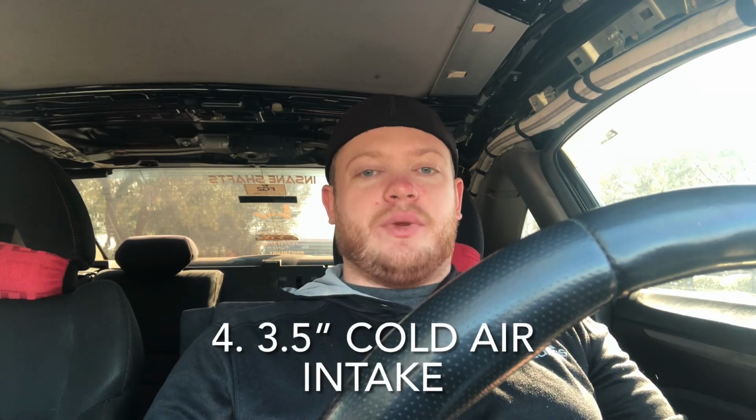All right, so now we're going to talk about intakes. You guys have probably been wondering why that hasn't been earlier on the list. But to be honest, there's been a couple cars that I've tuned with stock air boxes that have performed flawlessly, almost just as good as a short ram intake. So to be honest, it's not worth getting an intake unless you're going to get a 3.5-inch cold air, whether that be my Static Speed Race intake or the Hybrid Racing 3.5-inch.